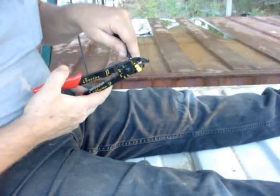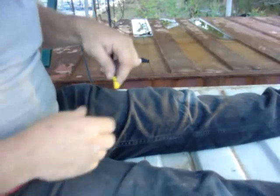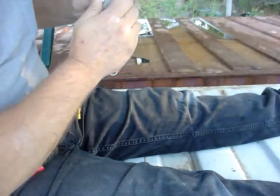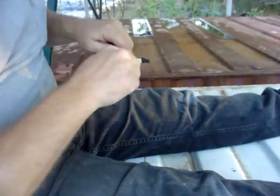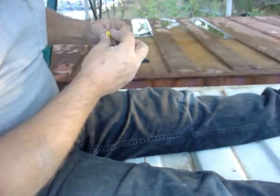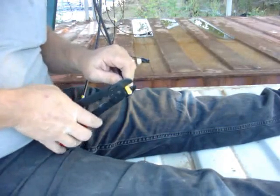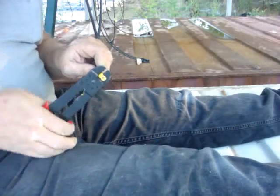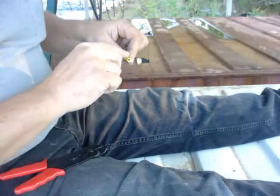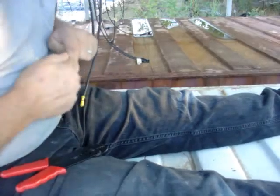Shove it in all the way, not letting any of the strands fray out. Come out dead center between the two lines and squeeze down. This is going to be my negative — one quarter inch only. Do not touch the wire after crimping; you wind up making it weak and it usually comes off. Stick it on there, find out which is top and bottom — right about there. If you try to squeeze any other way than through the top and bottom, the plates want to separate and you get a real weak joint. You can just pull them off.